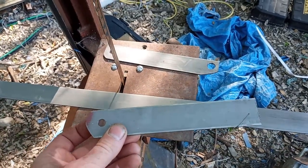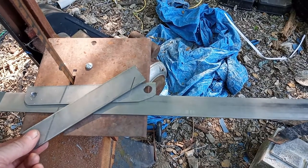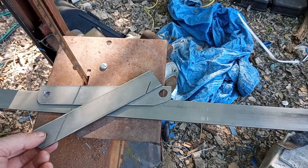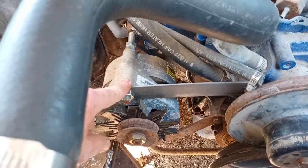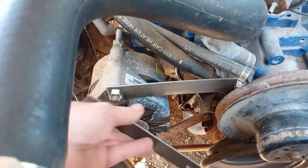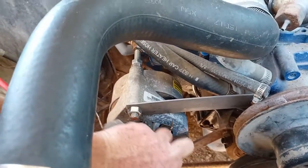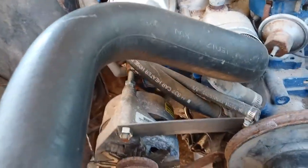This is an extra piece. What we're going to do is once we've got this piece situated, we'll hit the lower hole, move this up to make sure it's not going to make any impact on what's going on with the fan on the front of the alternator. Then I'll mark it, bring it back over here, cut it on the bandsaw, and then I'll weld it where it needs to be welded — and that'll give us a triangulated piece. You can see where we're at now: this is triangulated here. This piece has already been marked, and we'll connect from here to there so that we won't hit this. So that will line up my pulleys.